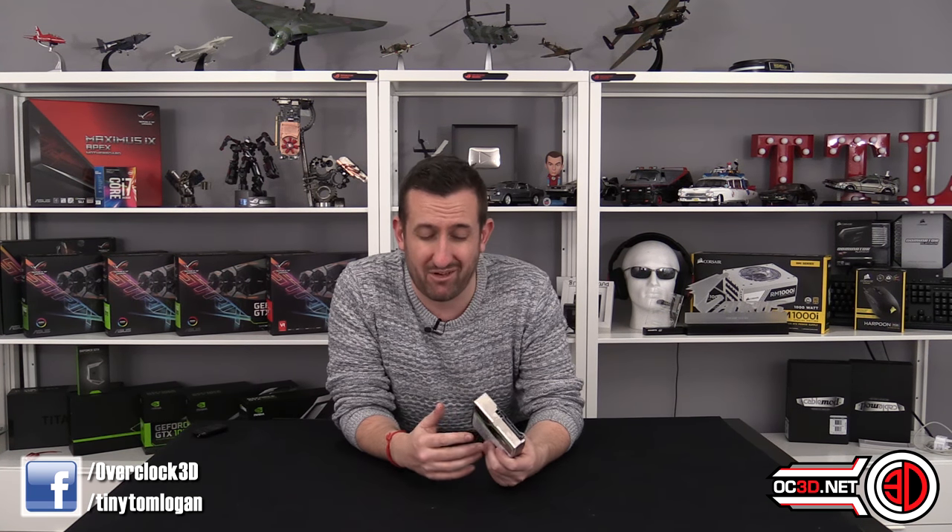The one thing you'd think is that with seven platters spinning around and all the heads, it would use quite a lot of power. But they report below seven watts, and it can fall down to three watts at idle. Which to be fair, unless you're running loads of them — and with 10 terabyte ones, surely you're not going to have massive banks of them — power use is pretty low.